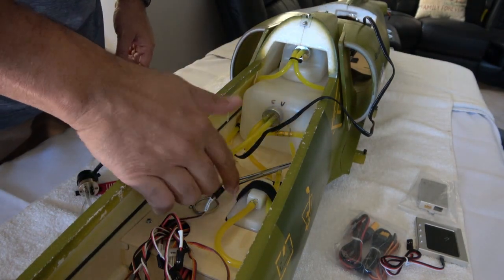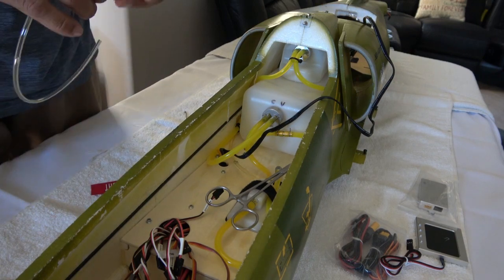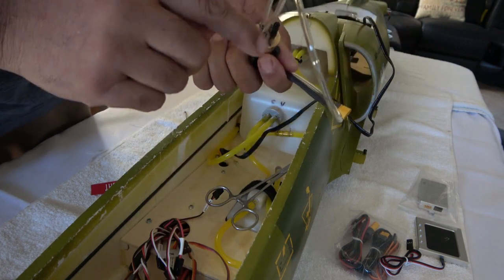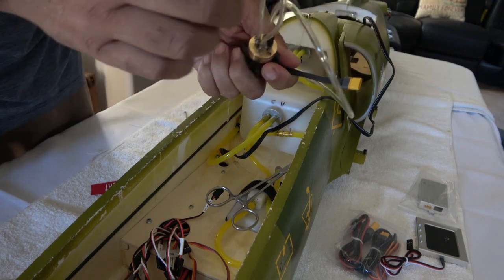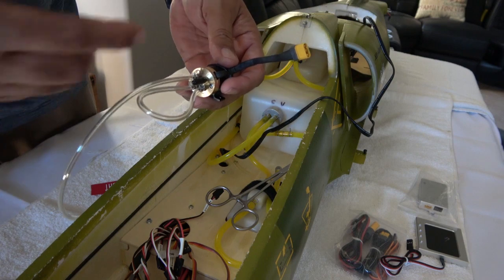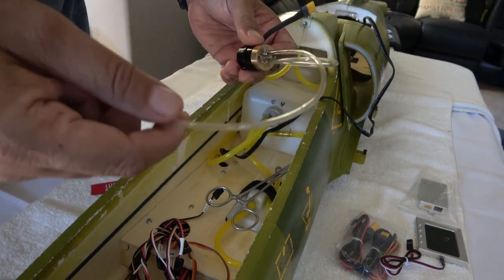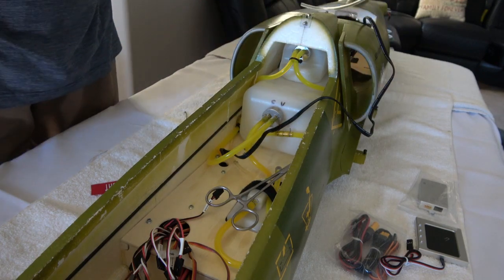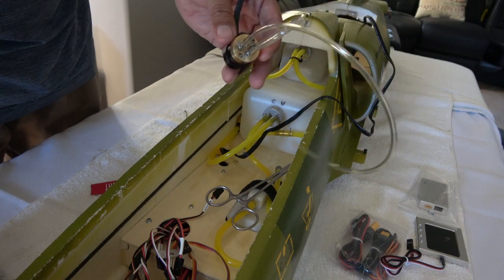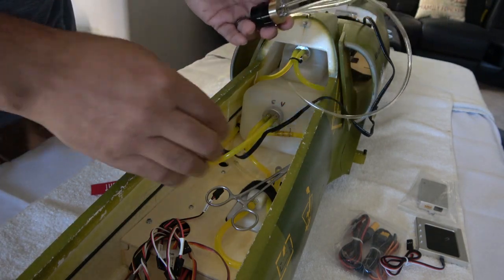Since my UAT is currently full, this is the line coming out of the UAT. I put a hemostat in there closing up the line so fuel doesn't spill everywhere. This is the fuel pump — it has two arrows on it. The line on the bottom is just a loop telling you which way the gas is going; you don't have to be concerned with that one. The one on top has another arrow pointing the direction of the gas: fuel comes in from the tanks and goes out to the turbine on the side where the arrowhead is pointing. Not everybody does safety wire on their lines — I highly recommend it, but it's up to you.